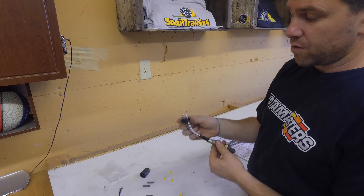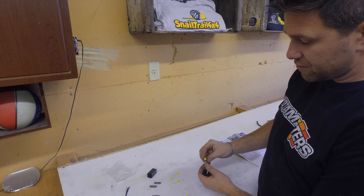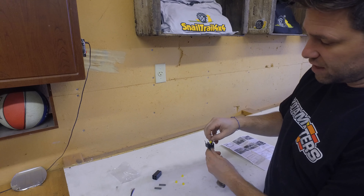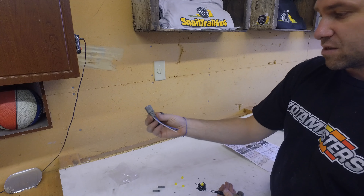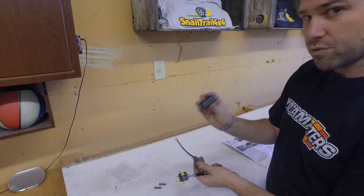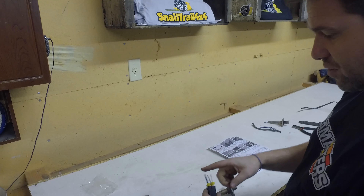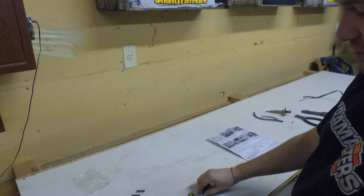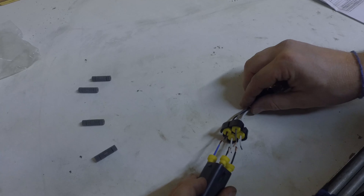First step is to separate all four and put the cap on. Then we're going to put these four waterproof parts over the top of each of these wires and push them down and over, bringing them down inside that cap. We chose to put the cap on this side and the big section on the side that has the clip, only because this side has more wires so we'll have a little more wiggle room with the larger section. It's kind of bizarre but the blacks on the old clip match up to the whites on the new. Our white and gray match up and the blue and black match up — that's how it's laid out.